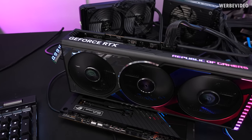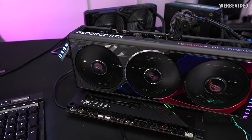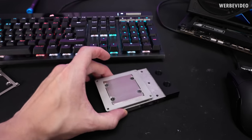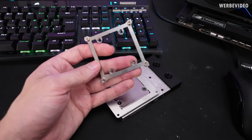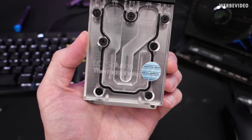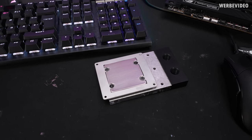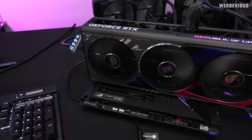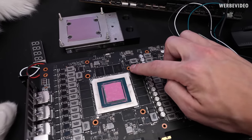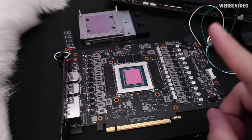This quick test even under GPU-Z render load isn't really a risk even with the XOC BIOS's disabled thermal protection. But I don't want to adjust any voltages yet with the EVC — for that I want to switch to this tiny water block. It's an older EK Thermosphere, originally designed for the Nvidia G80 — an 8800 GTX, around 2006-2007. It doesn't have a lot of surface area but should be sufficient together with the Mora radiator under my table. Using M3 screws works fine with the 4090's large-diameter mounting holes, and I attached four of them to the block.